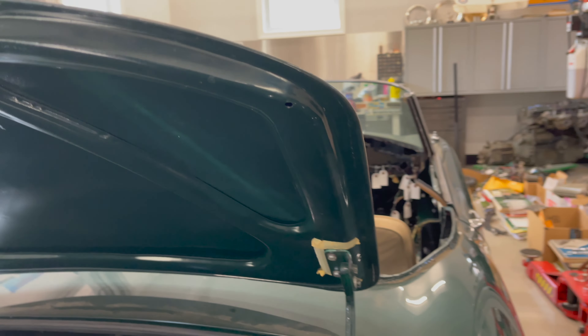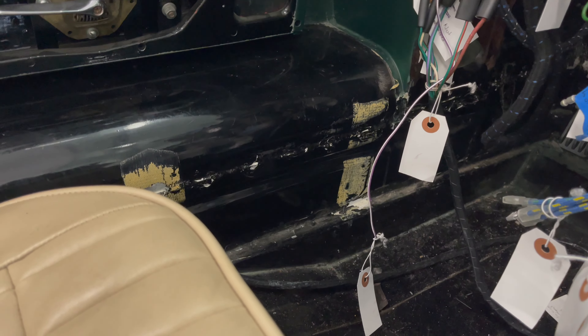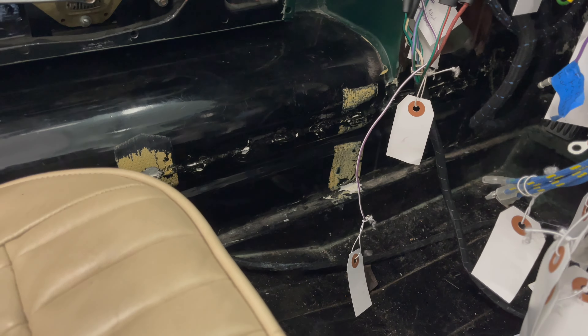I don't know whether the boot floor was replaced or not — it's kind of hard to tell right this second. Back here, all the rear chrome is back on and it looks excellent — it looks like it may have been re-chromed at some point in the past. The deck lid looks very good; I don't see any issues on the underside that would indicate any damage. Interior looks good. You can see by the rib in the inner sill that that is a replacement piece, and there are some patches on the floors and cross members — looks like the floor panels have been replaced. Here are new heel wells, and you can see they have a little bit of a harder crease up there, which dates those panels to probably back to the '80s. Everything is tagged and these are all new harnesses in here.